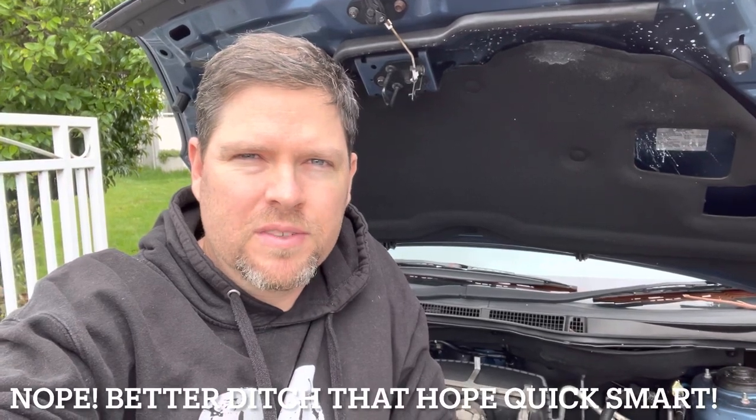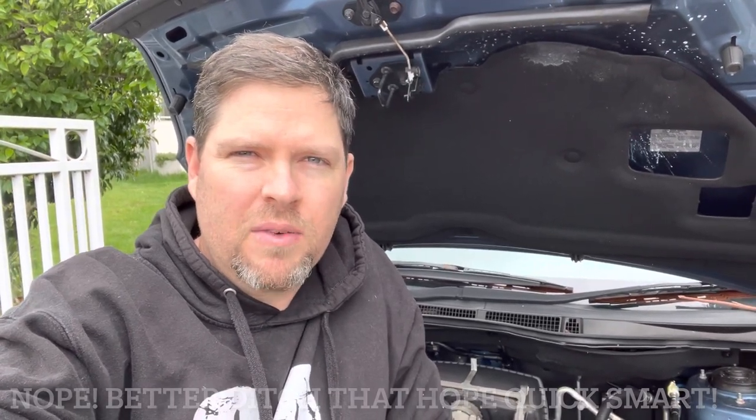But then suddenly after half an hour, it started to heat up again. So I'm hopeful maybe just some of that sealer stuff is broken free. So what we're thinking of doing today, we're gonna do a heater core flush, make sure the heater core is working, check the valves and stuff are working and things like that, since we're pulling everything apart again.